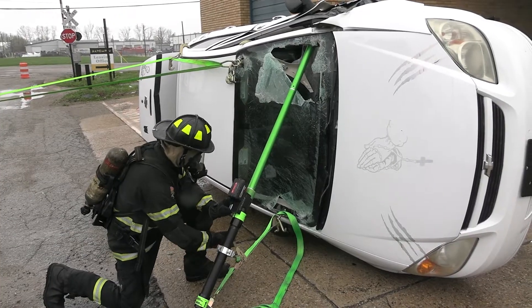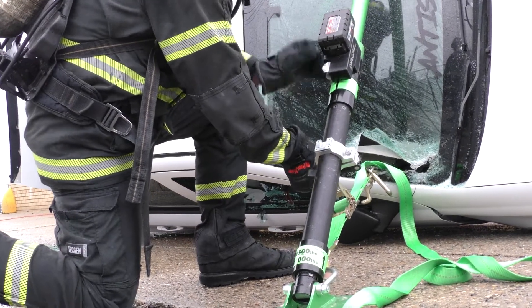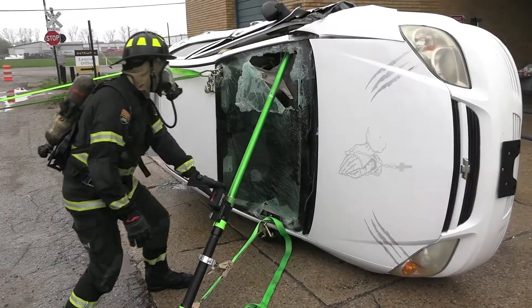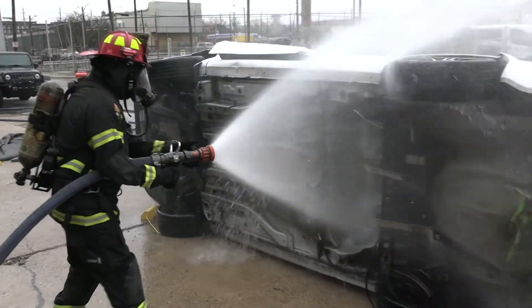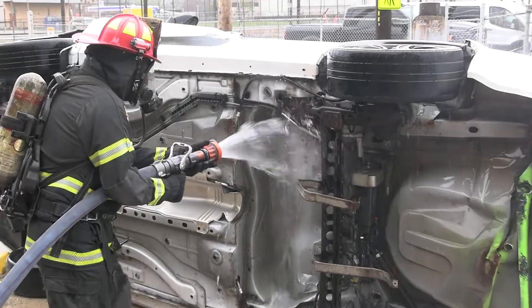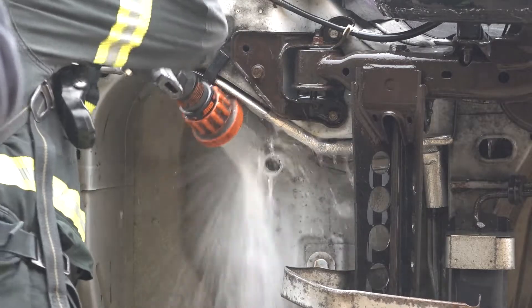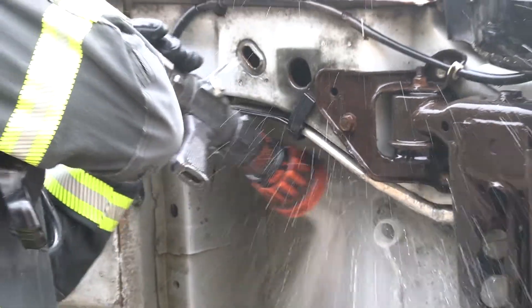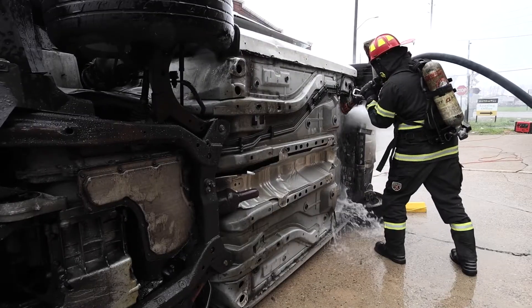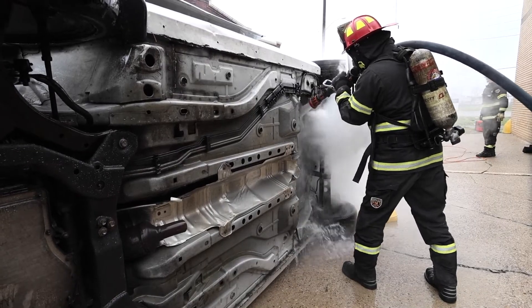Once the vehicle is fully positioned into a secure lateral rest, we stop on strut and then increase tension on the grip hoist, which creates a full tension buttress. With the vent point identified, the nozzleman approaches the vehicle with much better access, closes up to a stream, bails for a controlled flow, and attempts to manipulate the pattern around inside the penetrating hole for full cooling applications inside the battery pack. This more radical move — placing the vehicle onto its side — provides better access to fill the bucket and cool and fight any additional fires from this side position.